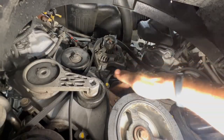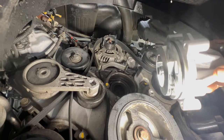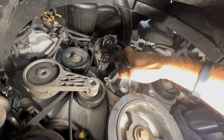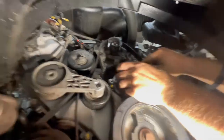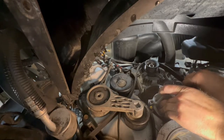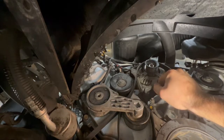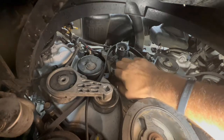All right, we cleaned all this up. Got our new water pump. We lubricated our O-ring just a little bit with a tiny bit of assembly grease, just so it'll slide in easy. So get your pump in here, just barely put it in there. And get a bolt starter because you don't want to be wiggling that O-ring all around — that's a good way to mess your O-ring up. So get two of your bolts started. Now with two of your bolts in, it'll guide you in. Just push — you heard it lock. Get all your bolts started.